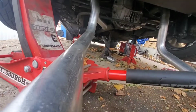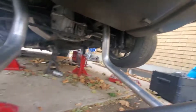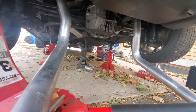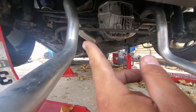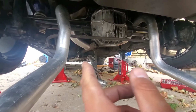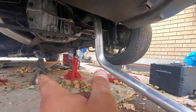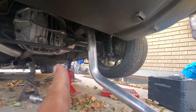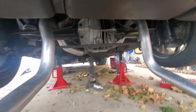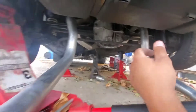The only bad thing about this is that it really doesn't have hangers, so I'm gonna have to weld my own. Luckily I have some. Hopefully this will line up okay. This one I don't have to trim too much because it almost fits exactly like that without needing a coupler or anything extra. This one, that flow tube is definitely way too long, so I'm gonna have to trim it a lot so it can fit over here. But hopefully this process is not so annoying. Let's get it.